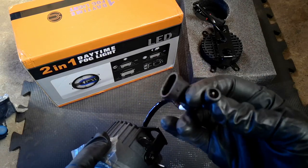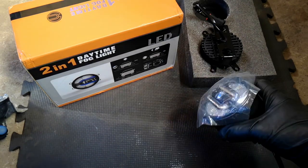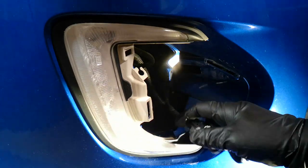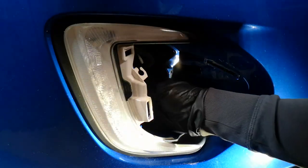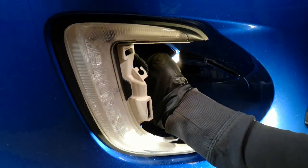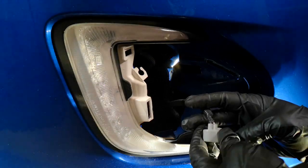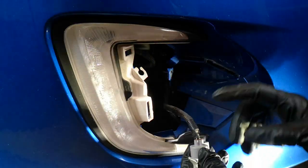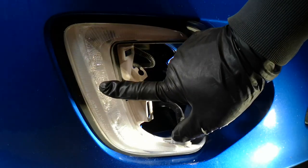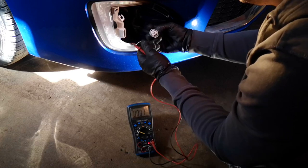This will be the original socket and that one will be for the daylight, so I'm just going to wire this one to the headlight cable. If I were installing only fog lights, that cable would be just fine, but I need to find the feed for the daytime running light, which I found right here. I'm going to measure which one of these three wires is actually the daytime running light feed — and this is it.